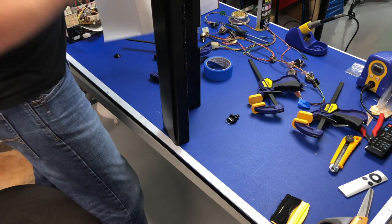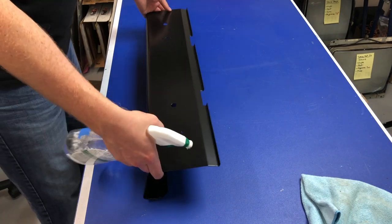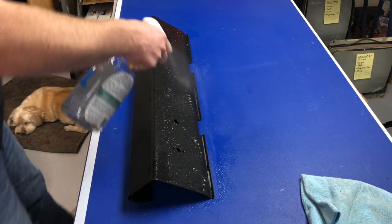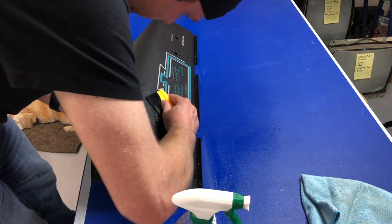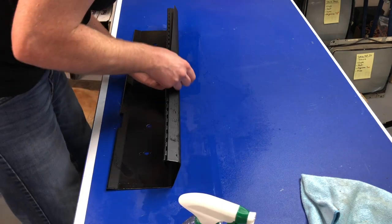At one point, I had to abandon my plans for using the dry method and switch over to the wet method. This involves soaking down the panel with some water and isopropyl alcohol mix, spraying down the sticky side of the artwork, carefully lining up the artwork with the panel, then squeegeeing out any of the bubbles and excess spray. It's messy work, but it had to be done.